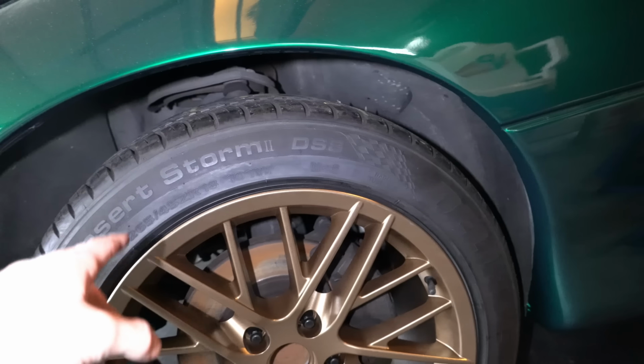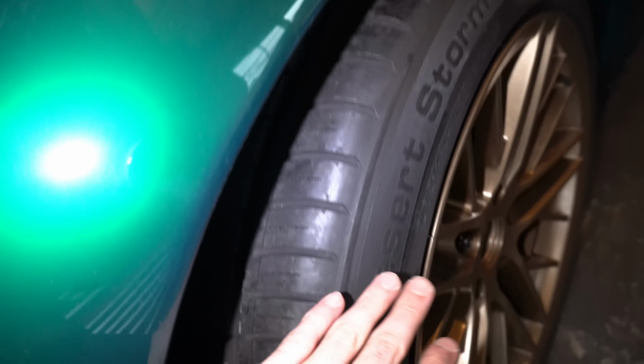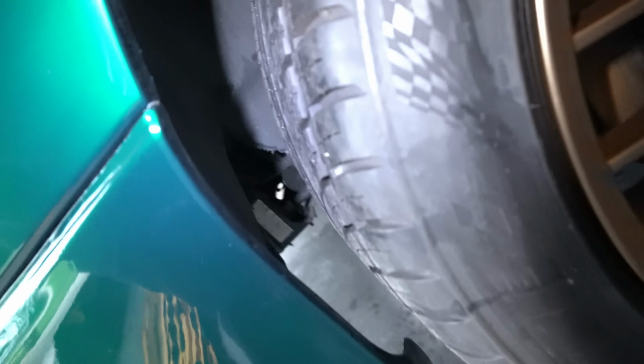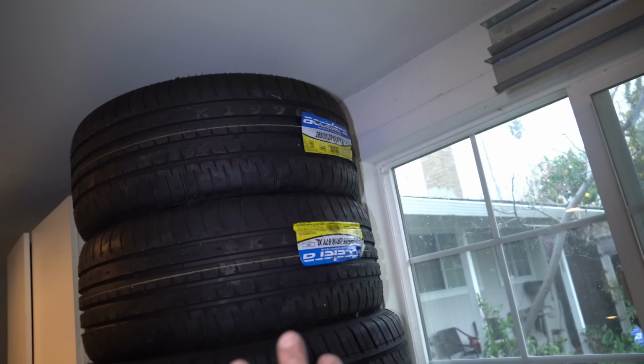A lot better. But we're gonna do the 275/40/18s just so it's not as rounded of a tire. You know, it'll sit a little bit more flat. But fitment wise, fits good. Don't think it'll rub anywhere. Not up front, not in the back. So those look good. I ordered those 275/40/18s, and until the other 10.5-inch wide wheels come, I'm probably just gonna put on the 8.5s.